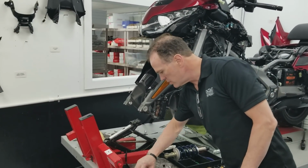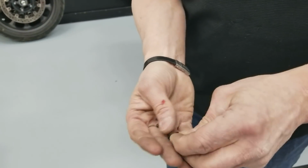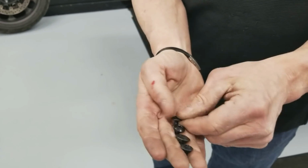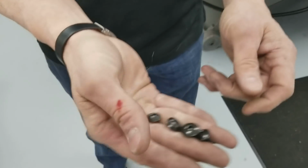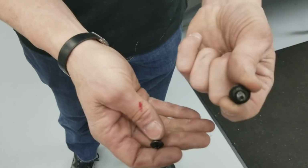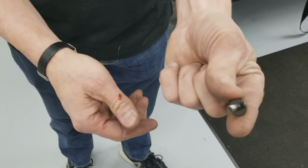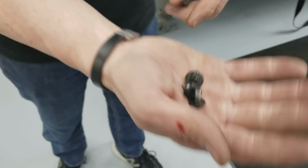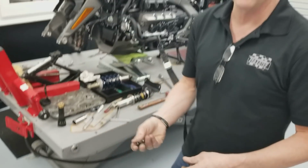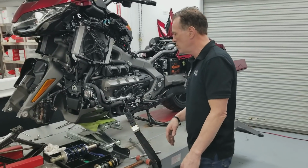And just to show you, what all appear to be bolts with 5mm Allen heads on them can all be extremely different in one way or another, right? A 5mm tool takes all these off, but one has a shoulder, one's got a 6mm bolt. These are 5mm bolts. This one has no shoulder at all, and these are all just on the decorative covers over the cylinder head. So, 3 different bolts in 4 different holes. You have to be aware as you take it apart and keep it organized. That's going to be really important.